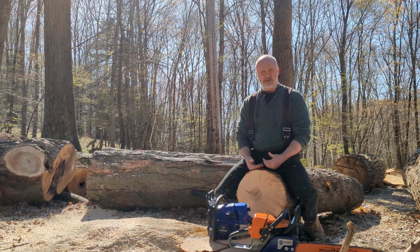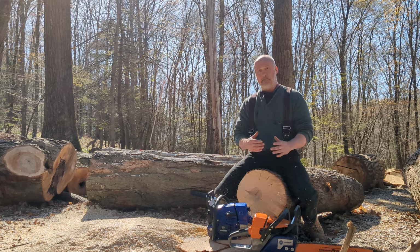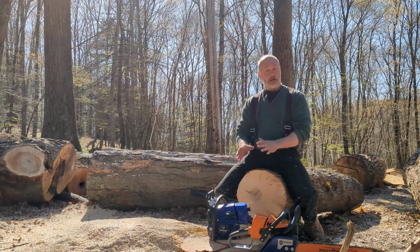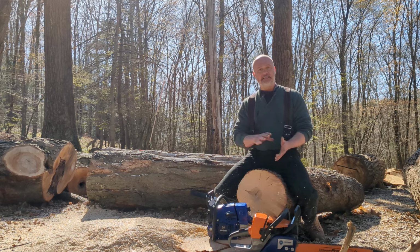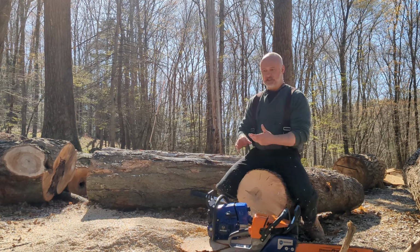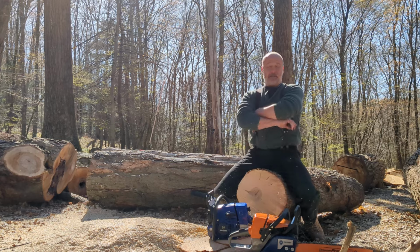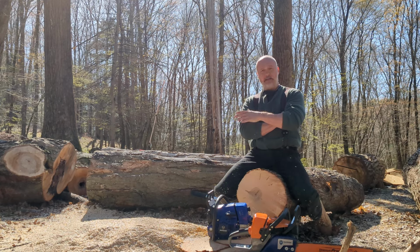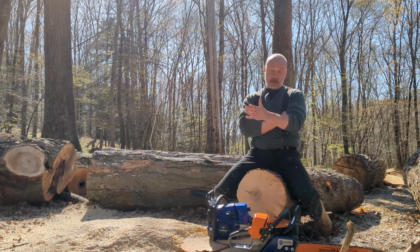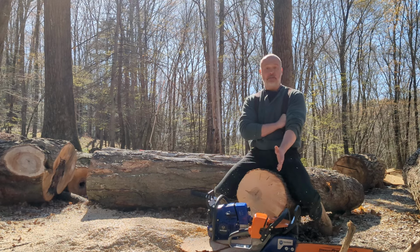I've also, on my personal saw, I have a velocity stack, and I'll tell you what, it keeps it a lot cleaner. I can't exactly prove how much of an improvement the velocity stack alone gives as opposed to the stock air filter setup. Maybe it lets in a little more air, but I wouldn't go crazy throwing a velocity stack on one, other than it keeps the air going in a lot cleaner than the stock filter setup, which I don't think is wonderful on these.